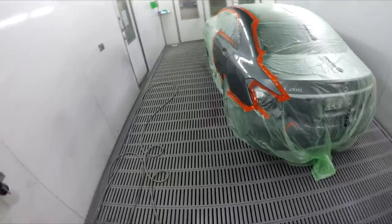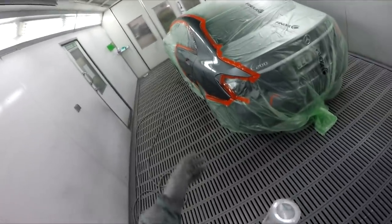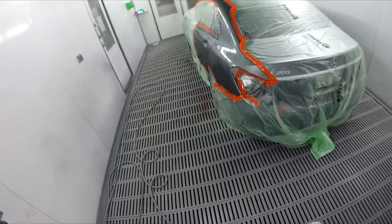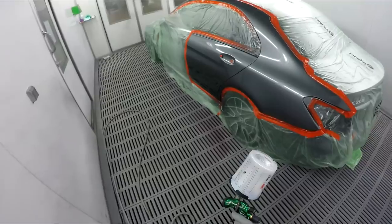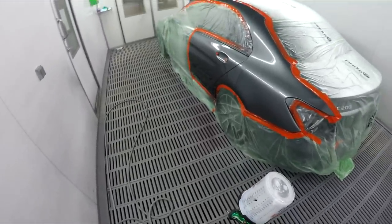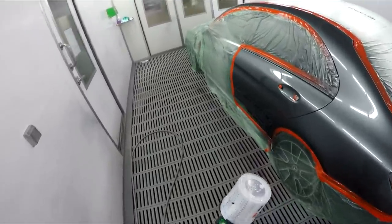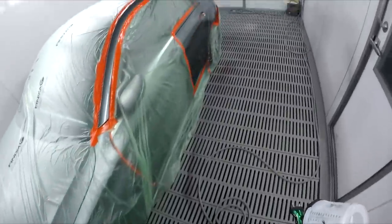If this was my last coat it would actually be too fine an orange peel, but I'm going to put a heavy one on for the second coat and thicken it up a bit. I don't want to rush it - I want to leave it for minimum three to four minutes. It's a hot day today; in the middle of winter I'd probably go have my morning tea, but I'm using fast hardener so it should flash off in about three minutes.